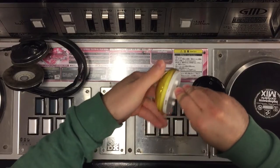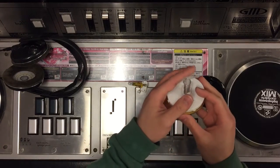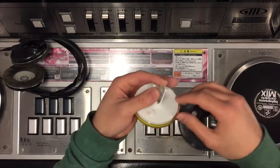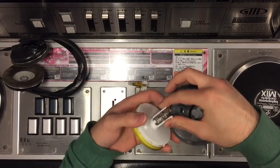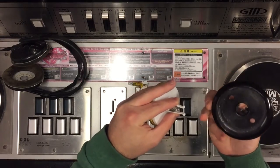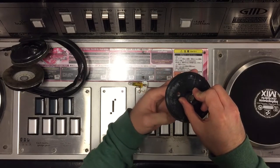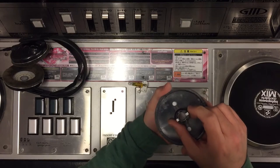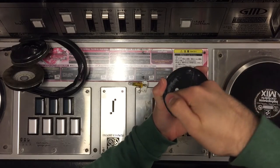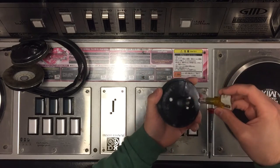Does this rotate? In any case, here's your switch — your spring, excuse me. Putting it back together is a little tricky if you're not using your head, but it really speaks for itself. You can't squeeze this with the spring in the way very well, so I like to, while I'm pinching it, work the spring back down about halfway. This should be fine. You're going to want to go through not where these protrusions are for the lamp holder. Check your spring — a coil could have jumped and gone past these protrusions here, so make sure that it's being held back by them — the spring base, or whatever you'd want to call it.